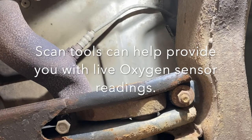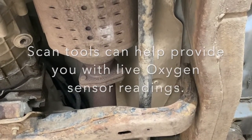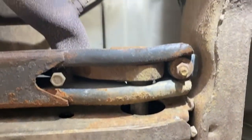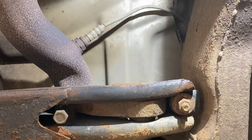When you're using a scan tool to diagnose oxygen sensors and catalytic converters, you have to be really careful when you look at that data coming off the scan tool. You must warm up your exhaust system and your catalytic converter to proper operating temperatures so they're hot, otherwise you'll get a faulty diagnosis. Also, O2 sensors, particularly in older cars, need to be brought up to temperature before you can trust the information on them.